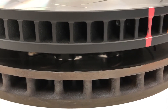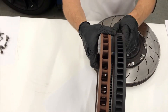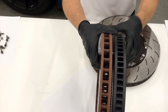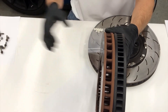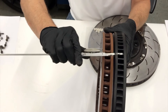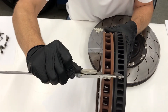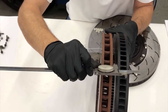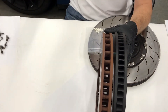The DBA rotor is made out of their proprietary brake rotor alloy and the rotor is heat treated. As you can see, that's a very dense vane pattern with lots of curved veins, and that's where some of the additional mass comes from. The GM rotor is about 33mm thick, and the DBA rotor is 34mm thick - so there's one millimeter of extra brake rotor there for you.